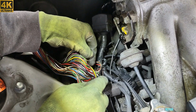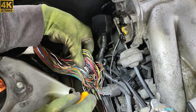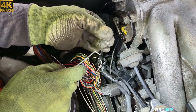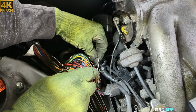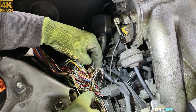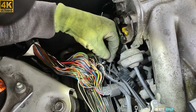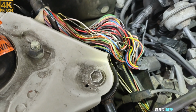Now if I come down here, they got stuck here again, because the first I went from here all the way to here, they are stuck here in the bottom beneath. This is the piece of insulation of this wire here, but the insulation is got stuck here on the other wire. The driver was lucky this vehicle did not set on fire. Some of these wires are for the injectors, and as I said at the beginning, also the injectors were suspected components. Now I got to separate after a little while of fighting here, and so I separated all of them.